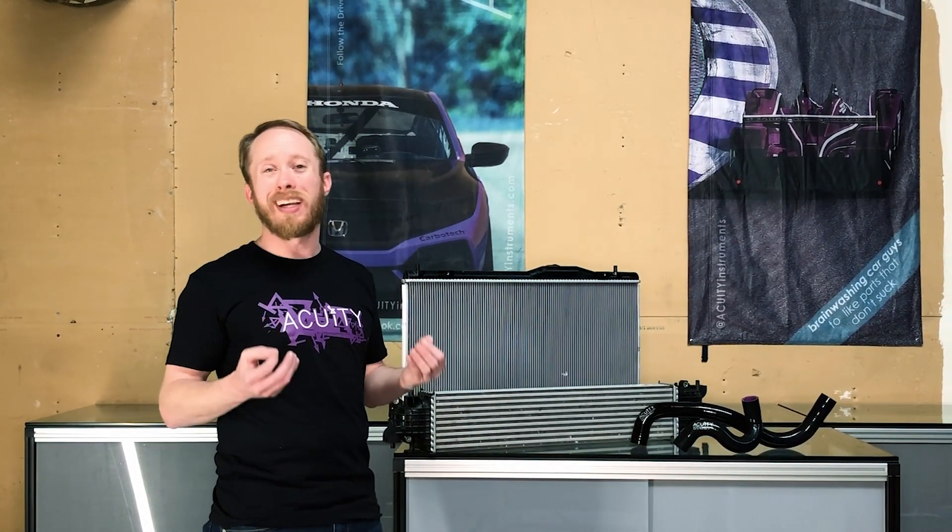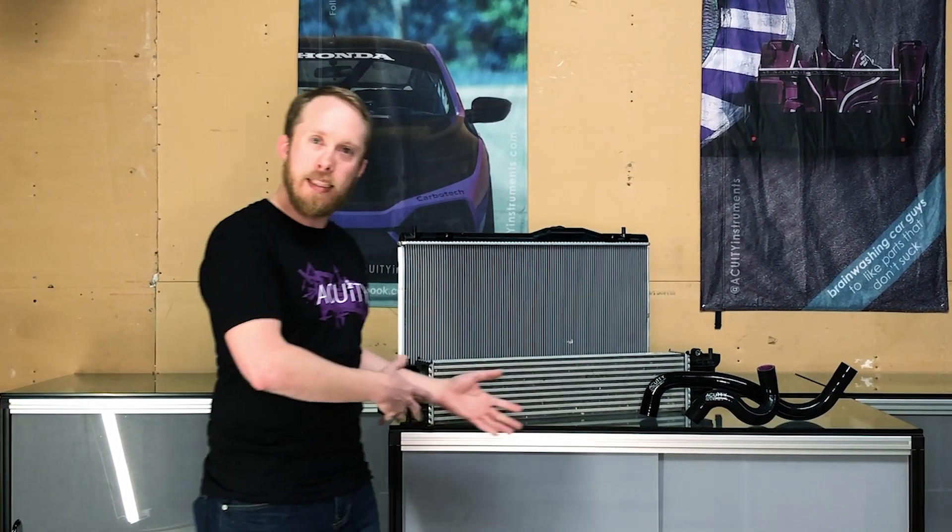That's why cars start to overheat on hot days when pushed hard — the air is hotter, so the heat exchangers can't reject heat into it. The engine doesn't stop making heat, the intercooler doesn't stop making heat, so temperatures climb until there actually is a difference between the temperature of the radiator and the ambient air. By that time, your water temps and charge air temps have risen to a point where you may cause damage from overheating. The key is to get those temperatures back down while still rejecting more heat to the ambient air — and to do that, you need better components.